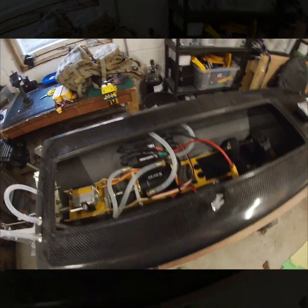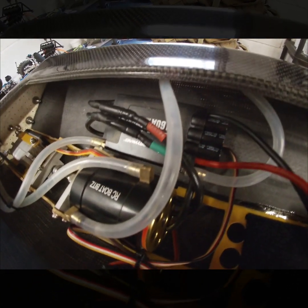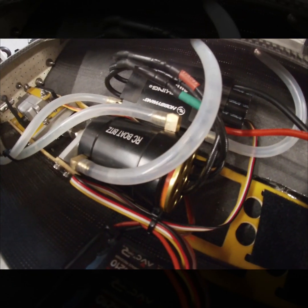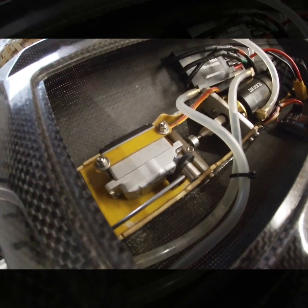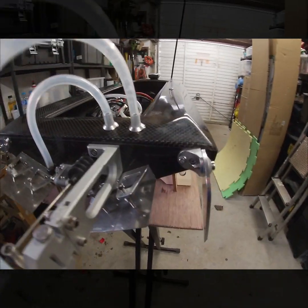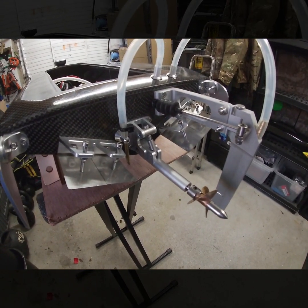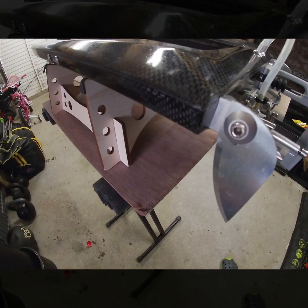We have got a 160-amp Seaking ESC, a TP 4030 motor at 1800KV. This is a 6S system. I'm running a huge Savox 30-kilo servo — total overkill — but this is Unrooted RC Workshops dual trim tabs on both sides, nice big stinger, lovely big turn fins — the biggest I could fit on there.